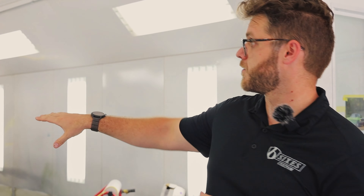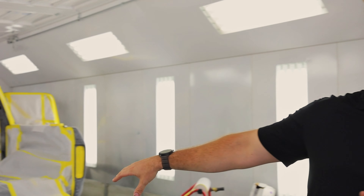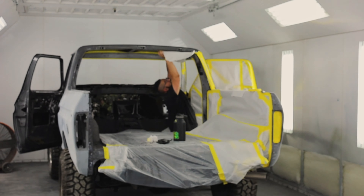Paint and body is a long process — normally they're in paint jail for six months or so. This is about eight to ten weeks of progress and we've gone all the way down to metal. We've replaced the quarter panel on the driver's side, which had some previous damage, had a bunch of dents repaired, and actually had to replace both doors — one was really rusted and the other had damage we didn't know about until we started stripping it to bare metal.